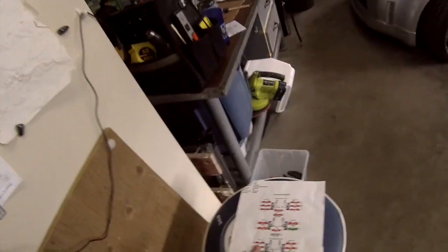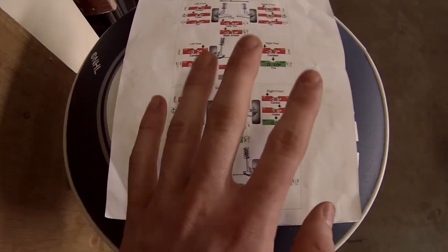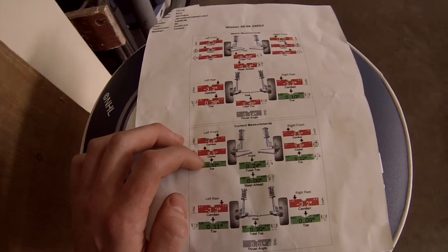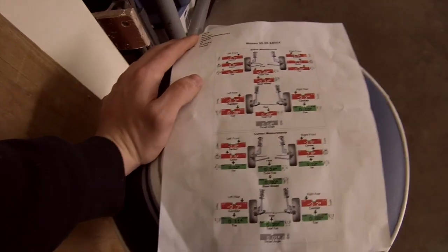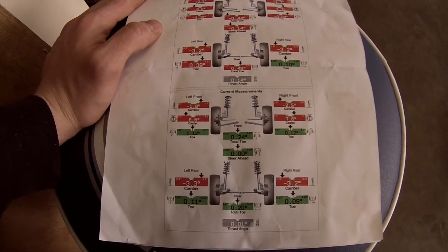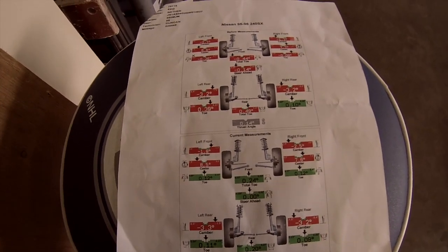So I'm going to be installing my adjustable suspension arms that I just got. The reason being is this is my alignment right now after I put my coilovers in, and you can see it's really not that great still. The camber isn't symmetrical — they adjusted the camber and caster accordingly to try to get it to drive as straight as possible, which it does, but it's still not how I want it. I have too much camber in the rear. People don't really realize how important alignment is, especially for drifting or any kind of driving really. That's why I'm putting these in.